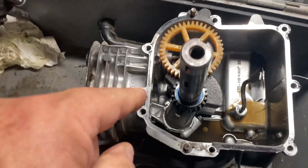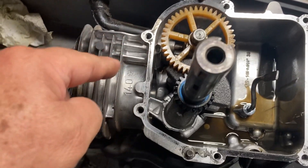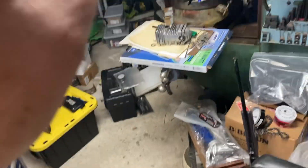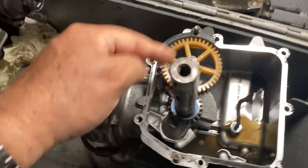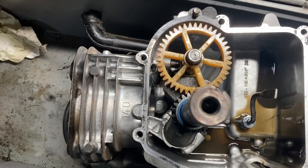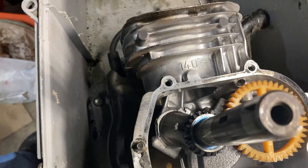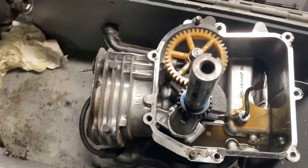If you guys are working on Briggs EX engines and you go, is there a problem with this cam? — it doesn't line up with the crankshaft properly. I had an actual other Briggs camshaft and I looked at it and they're both the same, exactly the same. So yeah, that's where the marks are. Look at the rod — it's at about 45 degrees; it's not at top dead center.